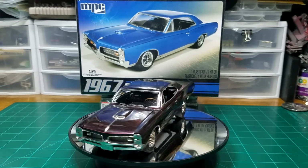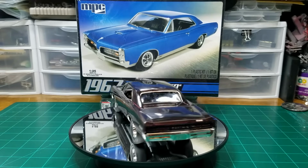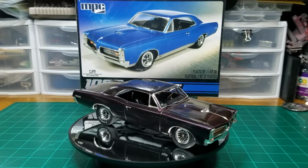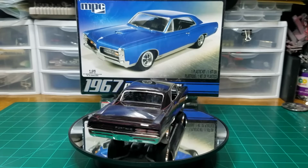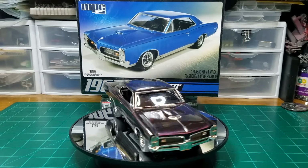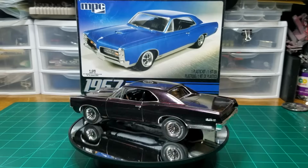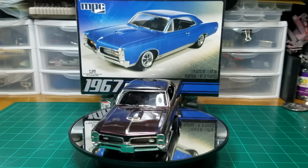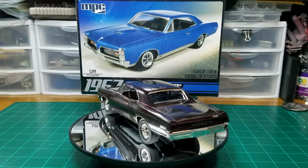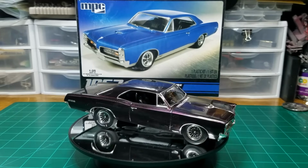Let's start with the front and rear bumpers. They are very ill-fitting, and by that I mean they're terrible. The plastic above the front bumper and grille has to be ground down enough so that the tops of the headlights meet with the underside of the fender housings, flush there. The rear bumper, on the other hand, has two tabs that stick up from the top of the back side of the bumper, and those are supposed to fit against the rear tail, with the tail lights.